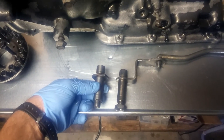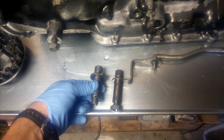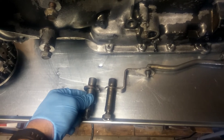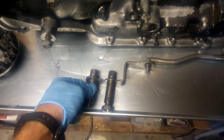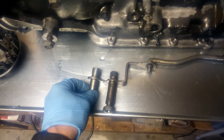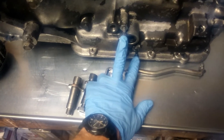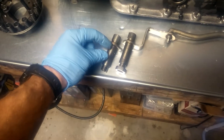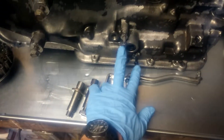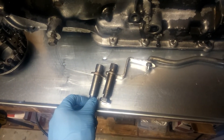This was the shifter lever shaft that TCI put in. As you can see, there's a little bit of material missing - this whole section here that hooks up to my linkage was missing, so they put an aftermarket shifter lever on there. With this chopped-off version and the aftermarket shifter lever on this shaft, I couldn't install the neutral safety switch, which is also the backup light switch, and that was bugging me.